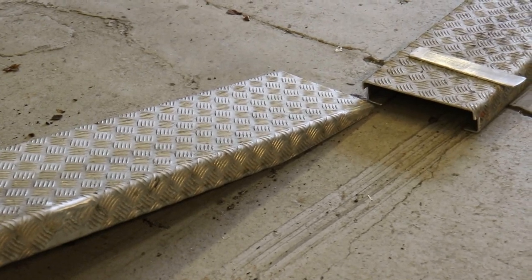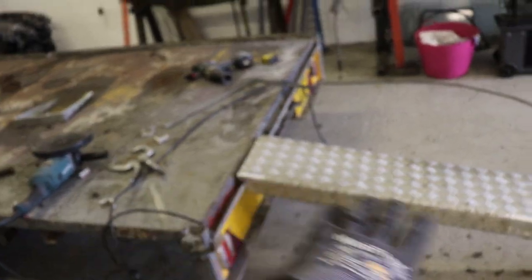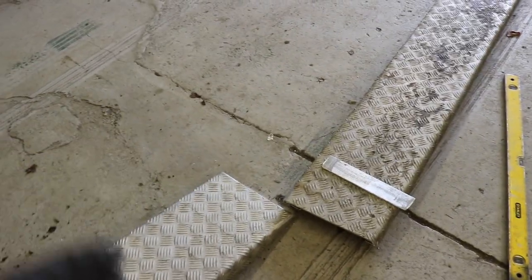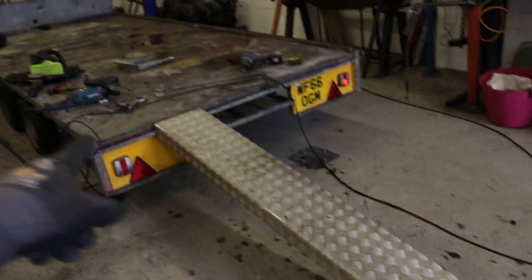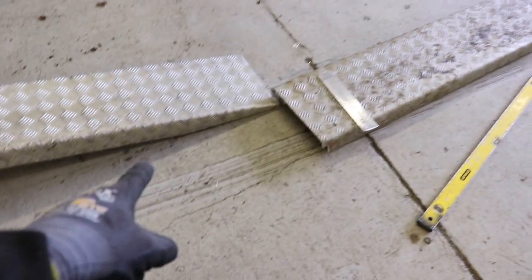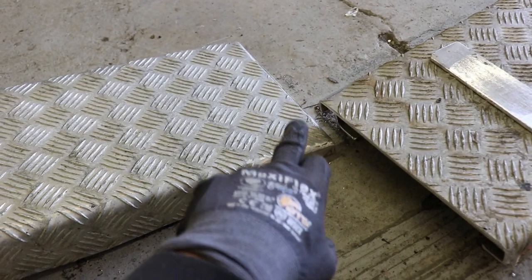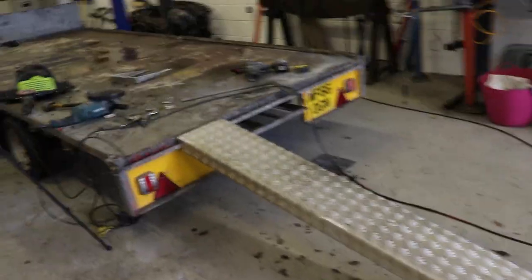I've gone a little bit over on the angle there, just so that to get a low car on this he's going to have to jack the front of the jockey wheel up so that the actual bed's tilting a bit - less ramp angle when you load. Just a little bit of extra room there to make sure the ends of the ramps don't lift off the floor as you drive up. Because if you don't have enough angle and then you lower this down, this corner will hit the floor and this will be lifted off the floor here. Then when you drive the car up on it, it'll rock on that bit and knock the ramp off the end - which I've seen happen before. So that's just to prevent that from happening.